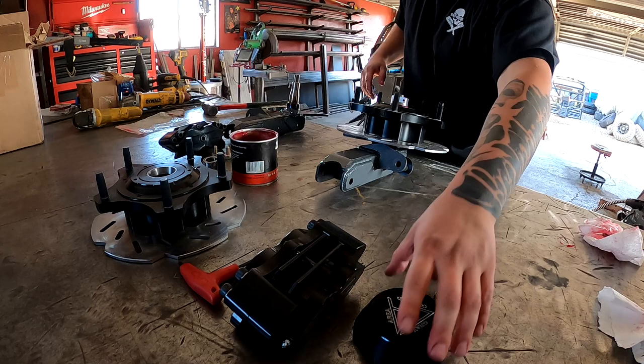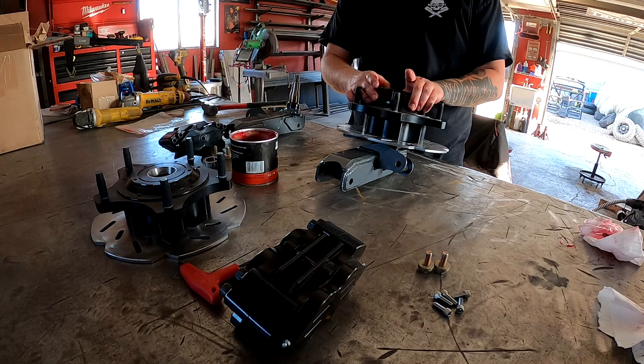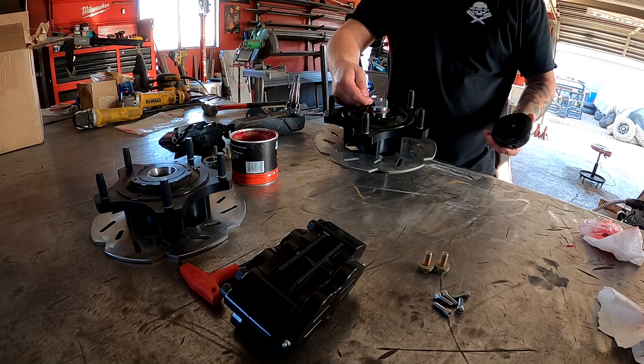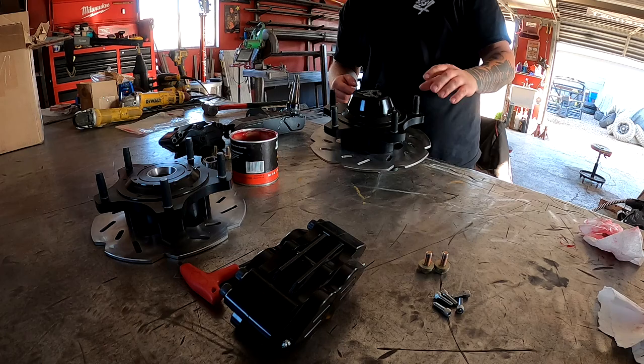Also, the dust cover, which goes on here. I already put the O-ring in here. So that's gonna go on there, and then you have five screws. What I would like to do first, though, is get it on the car, properly torque it, and then there's a lock screw here. I wanna get all that locked down before I bolt this on. So it's as simple as that.